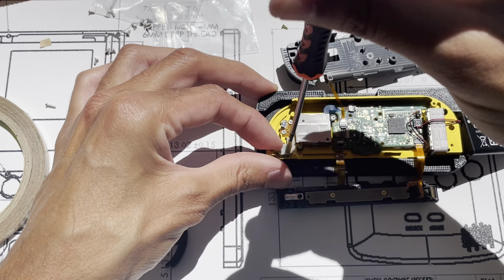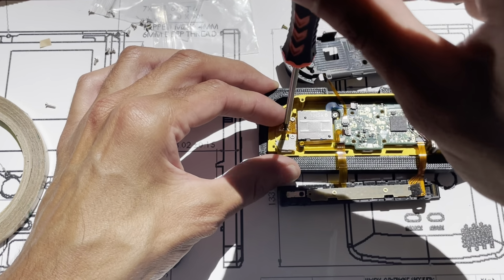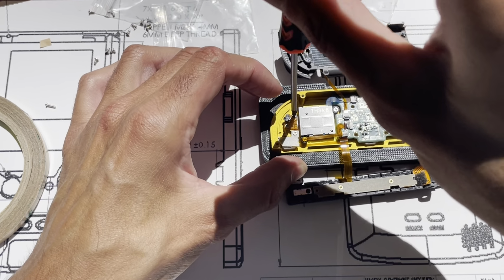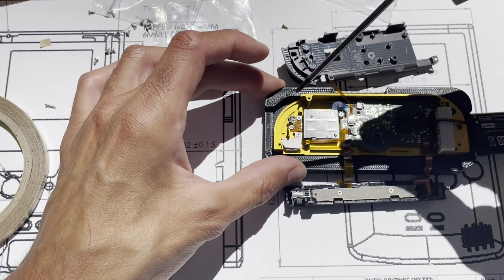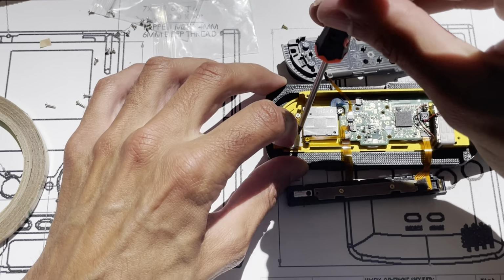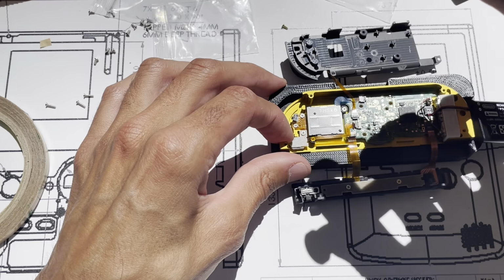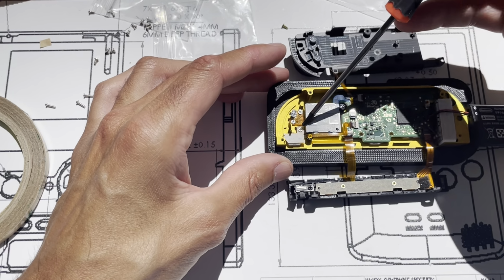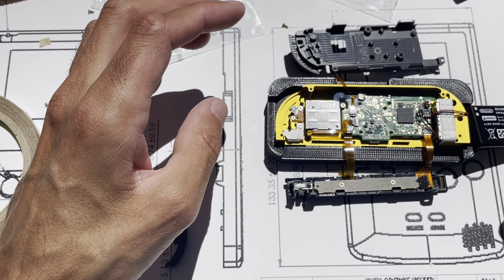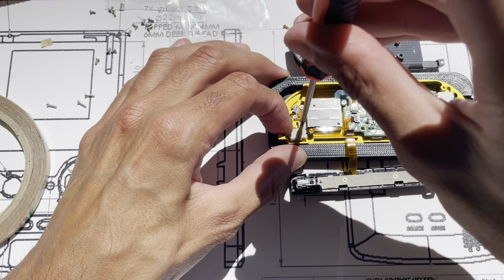Another thing you can try is sometimes these small fasteners, not a lot of thread engagement on these small little ones. They could strip. There's just not a lot of room to put them in general when designing it. So don't force them, but at the same time, they can get a little bit of gunk in them. I think it's from the anodizing process. There's a little bit of white powdery stuff in there, so every once in a while you may have to run this fastener in, run it out, and run it in. You could compress air in there to make sure, but just something to keep in mind.